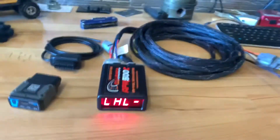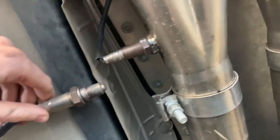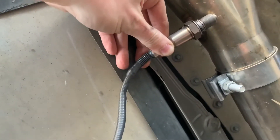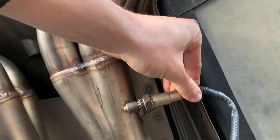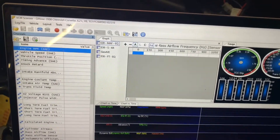We are calibrated now and the sensor is ready to go in the car. Common Corvette problem: we have long tube headers that have the O2 sensor bung sticking up at 90 degrees — that's great for narrowband sensors. However, when we compare the wideband sensor, we don't have enough room to get it screwed in on either side; it's too long. So this is one of those instances where, since there isn't another bung on the exhaust we can use, we have to use the tailpipe sniffer. We have the vehicle ignition powered on and the wideband also powered.